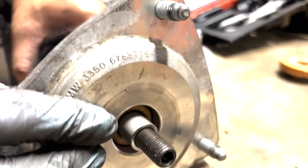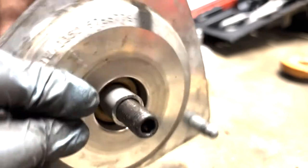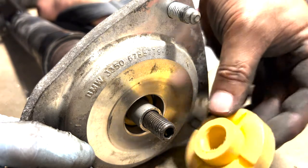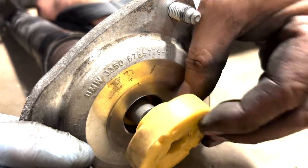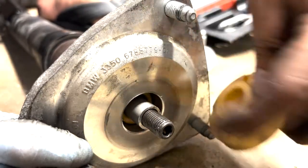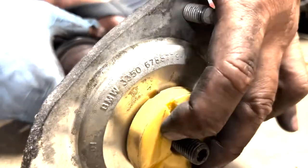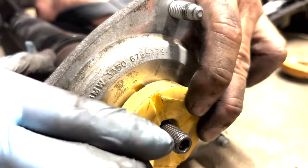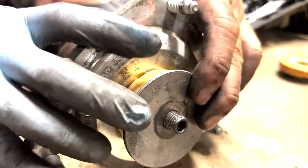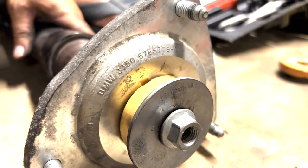Right? So now, that's a cushion. It's vibrating, and that foam is preventing noise, right? Then this guy here fits in the dowel opposite, like that. See this dowel here? It'll fit in this hole. So then you've got half of the hole on the bottom and half on the top filled in with this collar, like so. Okay? See how that's sticking out like that? Then this little washer here goes on top. And then finally, the nut, okay?